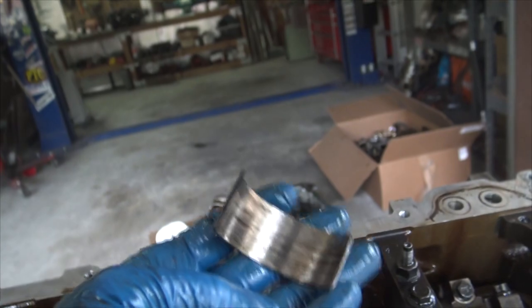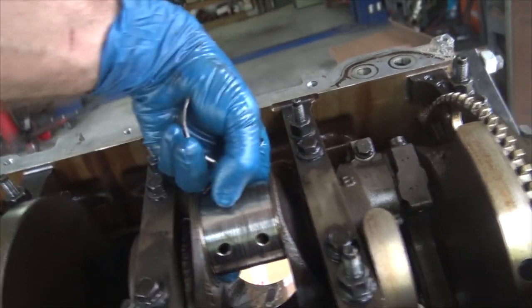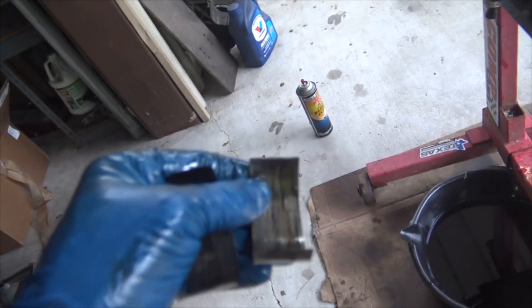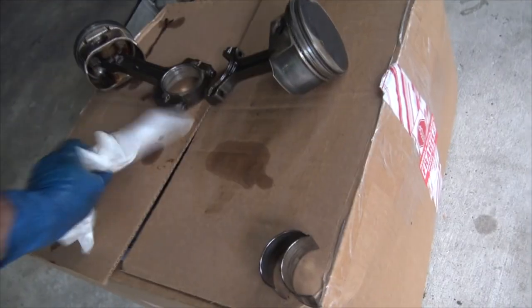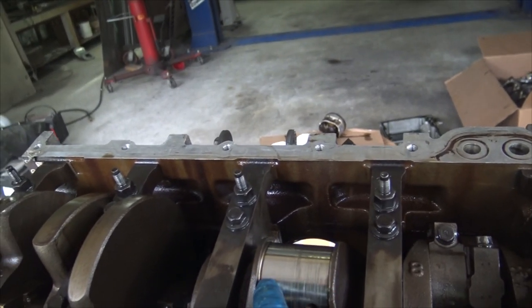Not too good, not too nice - which means this whole thing is going to be not too nice. This is probably like a hundred percent me not changing the oil often enough and it not getting the lubrication it needed. Since we see that the damage was done here but it also carried over to this journal - are all the bearings kind of trashed? If it thinned out and was just beaten up, this just happened to be the one that let go first.